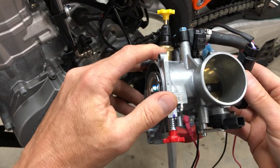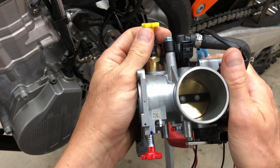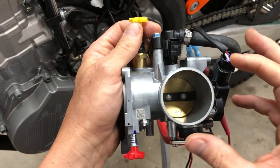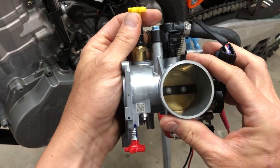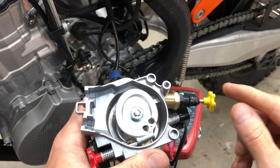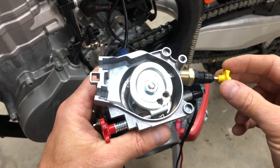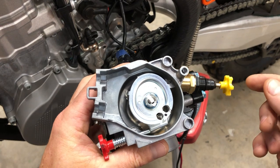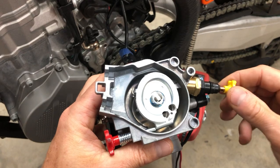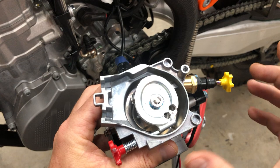And then when I release, when I go backwards on the throttle, the cable pushes that back out. So there's just a little, you know, like a spring and a ball detent in here. It's just click. And so that would be, I want to say choke because I'm thinking about a car, but it's not. It's fast idle. It's just more air, and that would be on and off. This knob right here is your idle speed, and in the other video, I'll explain how you adjust these and how you tune these and what happens when you do and how you increase the TPS setting, the throttle position setting, if you over-tune this. Maybe we need to do that in this video just for clarity. So that's what these two knobs are.